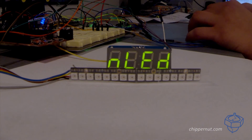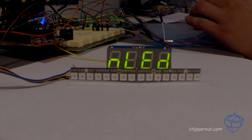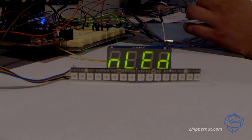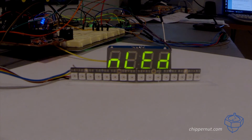The next option is the number of LEDs. This is really great because in version 1 you always had to change a couple of variables in the code, but with version 2 I sought to eliminate that. You don't have to touch the code at all or do any coding — you can configure the entire environment through the menu system. To change the number of LEDs, you simply click on this, it'll ask you how many LEDs you have, you push the button and it'll reboot. Then you can go back into the menu and continue configuring.